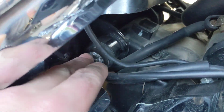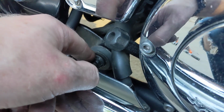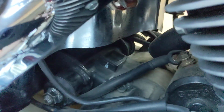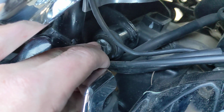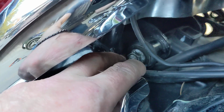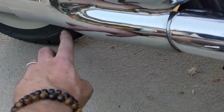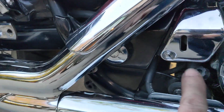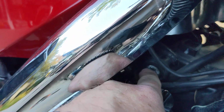there's the top engine bolt, there's the bottom engine bolt, and this, now that I've converted it to the Tourer, this bolt is longer on the Ace and the Aero, and it comes out and it goes through the top of that hanger, which comes up from below, so that those hangers coming along and then up, behind and through. So the top one's attached to that.